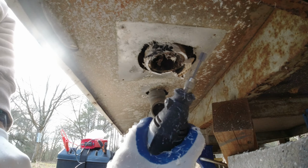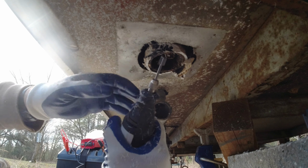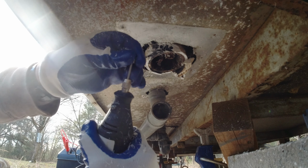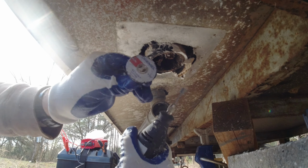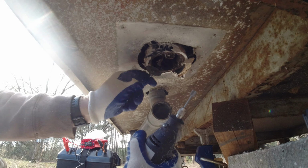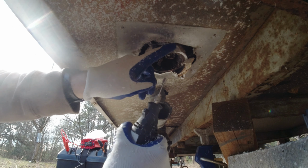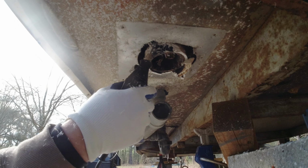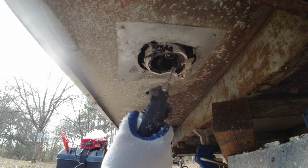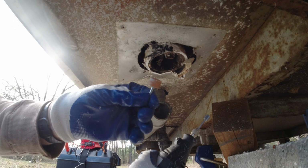Okay, well, I wanted to go over what I've been using to get this outer fitting down to the center ABS pipe. And what I found works well is this Dremel tool attachment. This is for carving wood and PVC. I think it actually says on the package, but I originally used this cutting wheel style to cut stripes in the outer flange, and then broke it off with some pliers, and then I basically have just a ring of pipe that's glued to this ABS, and no real easy way to get it off. I started cutting lines in it to try to break it off, and it wouldn't do. Then I got this grinding, polishing wheel that I had, and it does a good job.